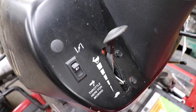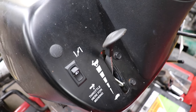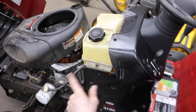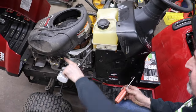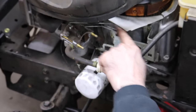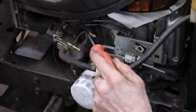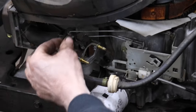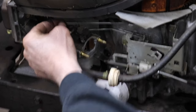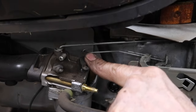That's just on Briggs and Stratton models — other engines work differently. If they have this type of throttle control, on a twin cylinder engine you'll have to follow the choke cable down and follow the rods that go to the different parts of the carburetor. One is for the throttle, which has the idle screw, and the other one's for the choke.